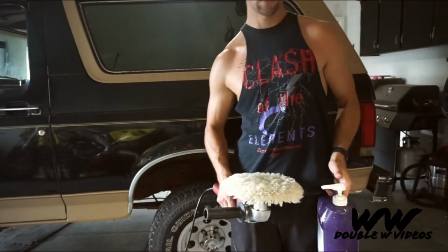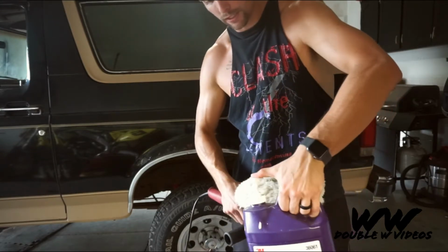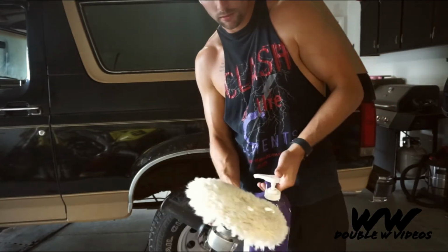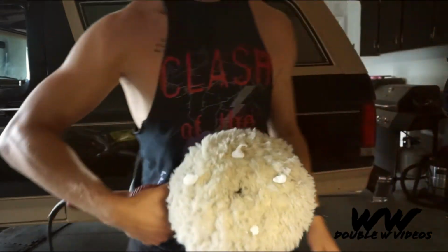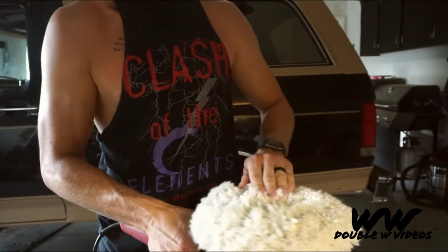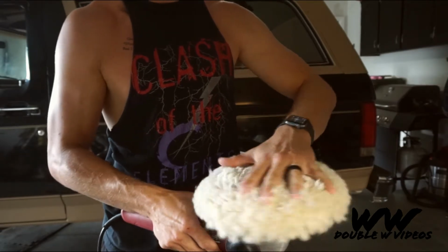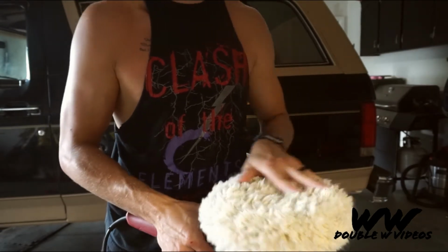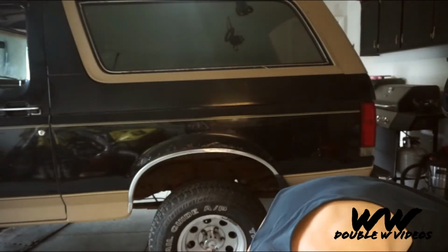So let's get started. What I found out when I first started is I was using too much compound. Not only that, but I wasn't evenly distributing it. So what I found for me is I get it on the pad, kind of like that, and then I rub it in. Yeah, it's messy, but who cares? Get it rubbed in real evenly. That'll help with keeping it from spraying everywhere like it did when I first started.